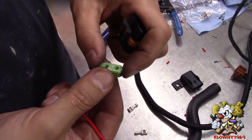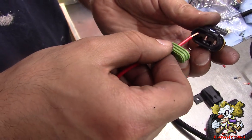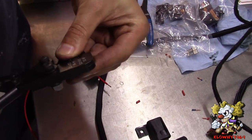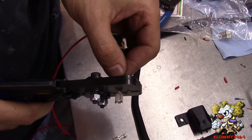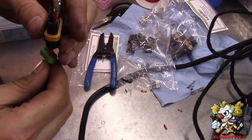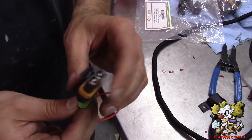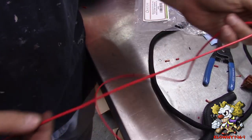In the back here you pop this off, insert it in the hole, pop that through. These are the terminals you're putting in - then put this in the tool, or you can also use this to crimp it down, but I have the tool so pop that in there. Now you can pull this straight in. Do the same thing on the other side. That is ready - just put the fuse in there and mount that to the car.